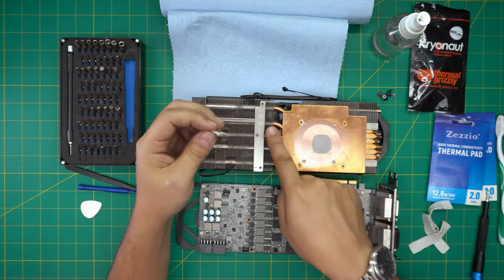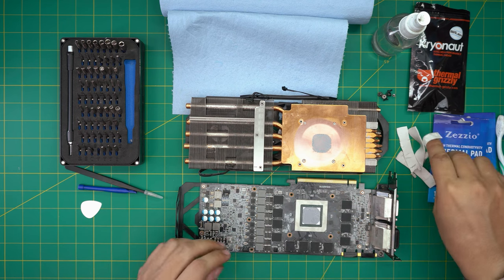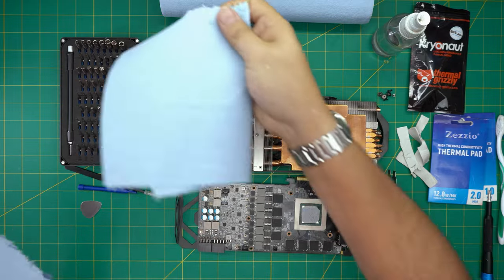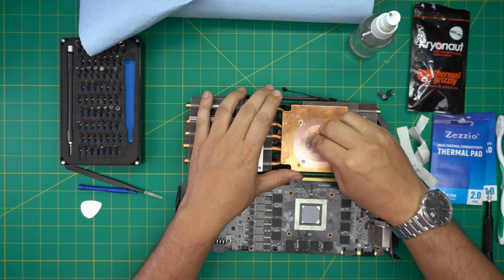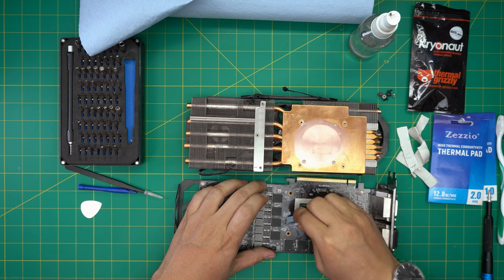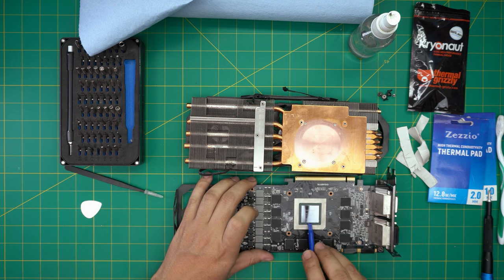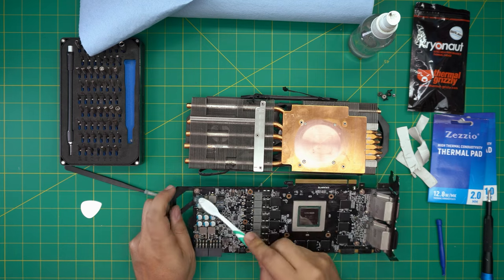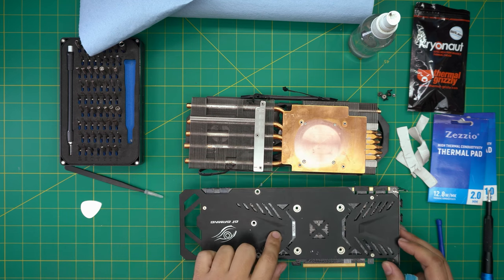This thermal pad over here is for the power regulator — that's a one millimeter. The VRAMs use two millimeter pads. We're going to do something with the thermal pad at the end to make it a bit better. They've changed the thermal paste on this one before, so we're going to clean it up with alcohol. Rub it nicely and make sure it's clean. On the GPU die, be careful around capacitors and use a plastic spatula if needed. You can also use a toothbrush to clean dust off the board, or take it outside and blow some air through.